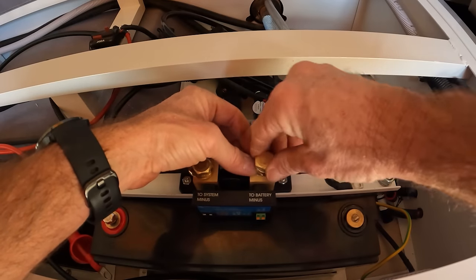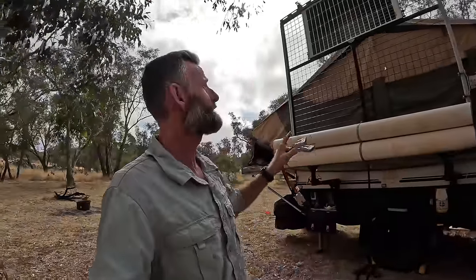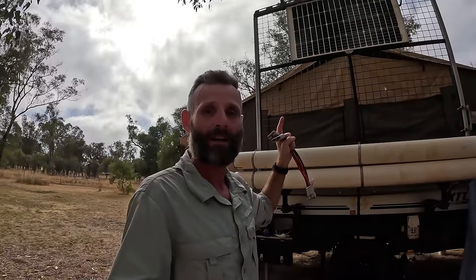I did a lithium battery upgrade in the camper and as part of that install I also fitted a smart shunt — that's a great way of finding exactly what your state of charge is; you can see all your current ins and outs. I did a video on that smart shunt installation — go through our playlists or check the link in the description below. Depending on your power requirements, the 120-watt panel that came with the Robo is probably not going to be enough, and when you're at camp you're normally parked under a tree so you can't always face it toward the sun. In my opinion that's not a big enough panel — get yourself a portable panel.